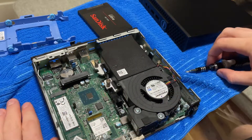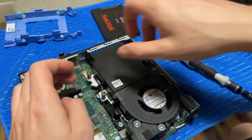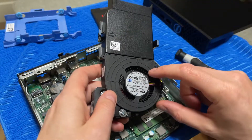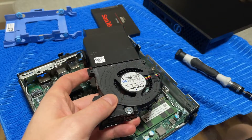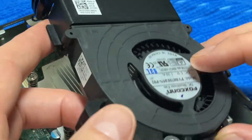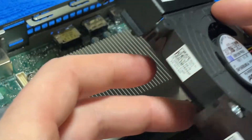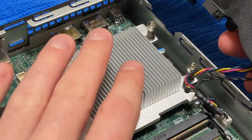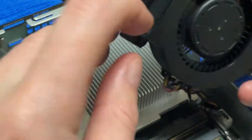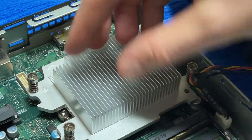I don't actually know how to take any of this out — it just clips off, it just comes out like that. So you get a fan there, nothing crazy. It'll move air — it'll be something kind of like a laptop-based cooling. The interesting thing is that's not sitting over top of the cooling system — it's going to blow directly in here. You have a fin here and then you're going to push air over it, so it should actually cool pretty well. All the air will come out of this vent and push through these fins. I suspect it'll have decent cooling — it's not going to be groundbreaking, but it should be reasonable.